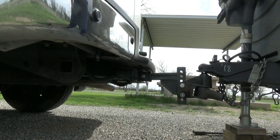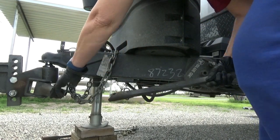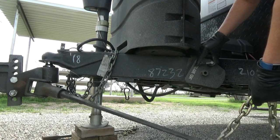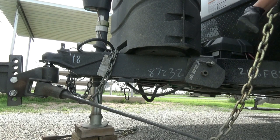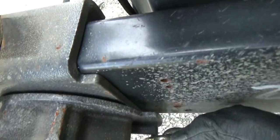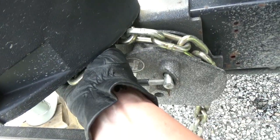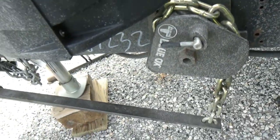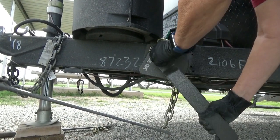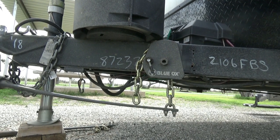On the Blue Ox, it is just the one piece with the chains. I'm going to snap the front end — there's a little hole — and snap that into place on the part that is in the van. Then I am going to be counting chain links to see how many I use to lock it onto the lever and back. We have found that 10 works great for us. Essentially, the more links you have, the tighter the anti-sway is going to work. Ours works great with 10, but it will be different for each person. Once I lock that in place, I always double-check to make sure it is actually locked, and then I repeat the process on the other side.